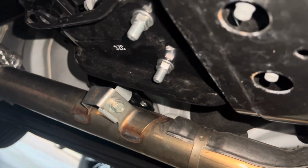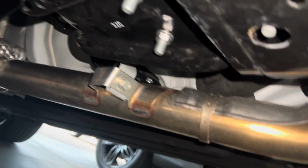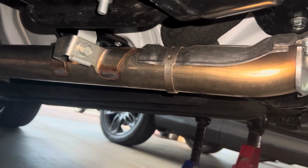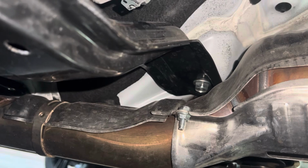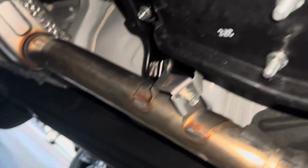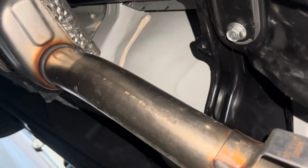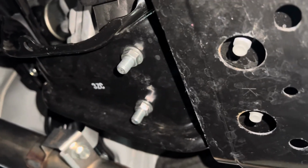Grab this torque spec for these, I think these are 12s. Yeah, these are 12s. 14, sorry. We'll get this torque spec for the 14s. So we're gonna get these guys first at 76 foot-pounds. Okay, all the 14 mils, your transmission mount, this brace, and the back side of it, they are all 51.6 foot-pounds. So we're gonna hit them with 52 foot-pounds. And we'll be all torqued up.